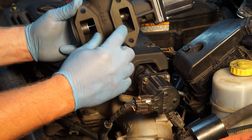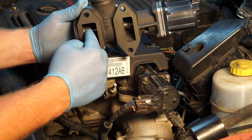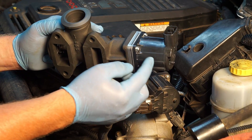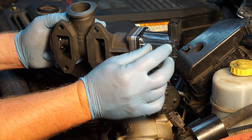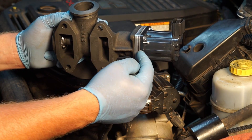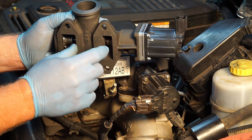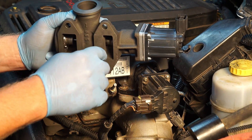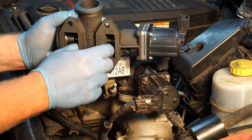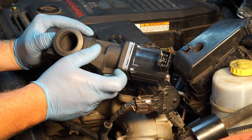We've got the intake gases right here, so it's going to get mixed through. This thing is normally default through a spring in the closed position. There's a stepper motor here with a position sensor built into the motor itself on the end. When the EGR is commanded, this motor is going to energize and actuate the valve to slide, allowing exhaust gas to flow into the intake and be drawn in, mixing it. Again, this is default to the closed position.